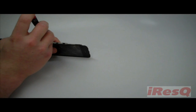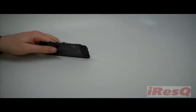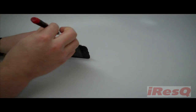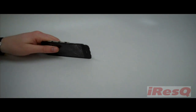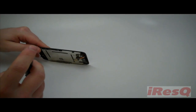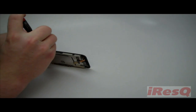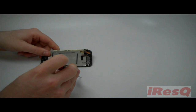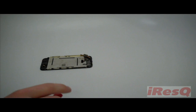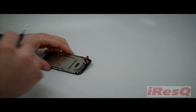power button. Now that you've removed the front panel assembly, we need to remove three screws on each side of the frame that attach the LCD to the digitizer. Once these six screws are removed, we will gently work our standard screwdriver between the metal side rail of the frame and the metal backing plate of the LCD and gently work the LCD out of the frame.